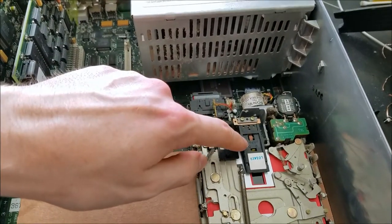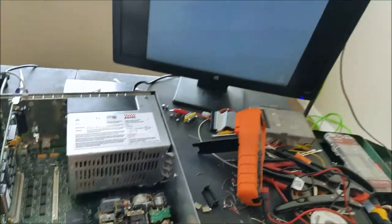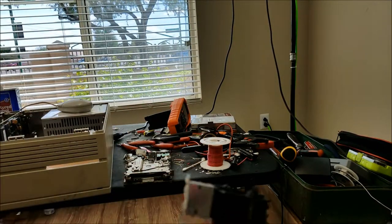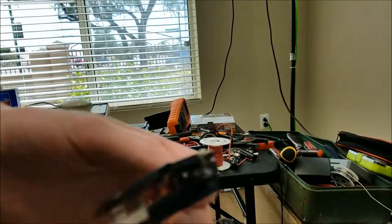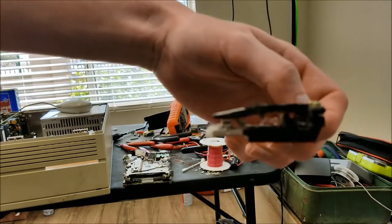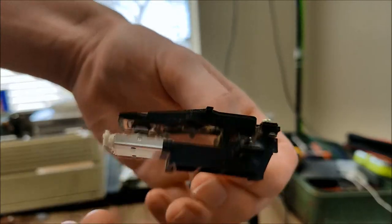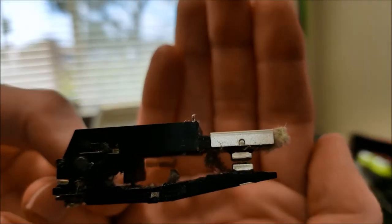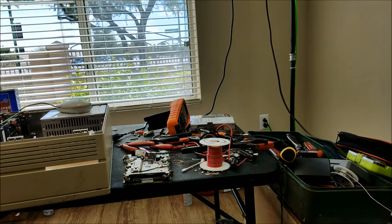I'm going to have to see if I can come up with something to just give this a little bit of down pressure here. I think if I can fix that, this project will be good. So I've got the head assembly out here. It turns out there's actually a spring - that's what actually provides the head tension. That's what must have got stretched. What I did was pull it up a little bit so that it hooked on lower down in the swing to give it more tension. You can see now the heads are pulled pretty much together - they're touching. Be very careful because you don't want to smash them together. Now if I turn it upside down, you can just see a little bit of gap opening. Hopefully that'll be enough tension for them to work. I'm going to put it back on and see what we get.